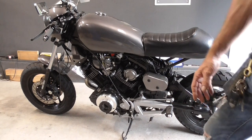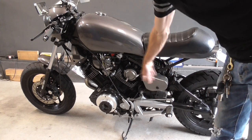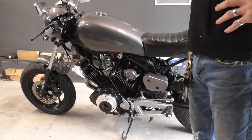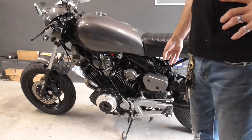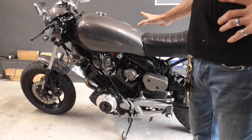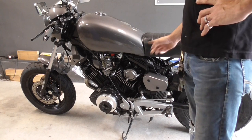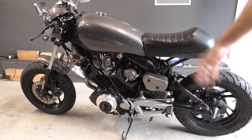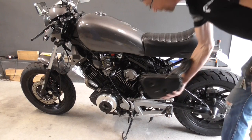The things we've changed on the bike: I put on a really open air filter that gets a lot of air in it, so that changed it. Also the exhaust has about half of the baffle, so it doesn't have much back pressure. If I want to figure out how much is related to the exhaust versus the air intake, I can put the stock air intake back on. If it runs like normal, then anything still off is attributed to the open exhaust. So we're going to switch that out, fire the bike back up, and see what it sounds like.